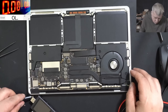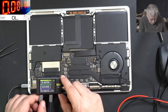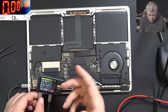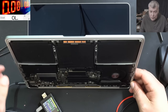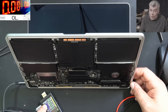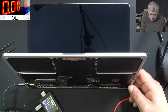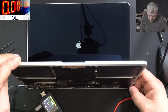That's what happens when someone opens the laptop. Now with the cable reconnected: 800, 900 milliamps, 1 amp, 1.1, 1.2, 1.3 — the battery starts charging. 2 amps. Someone had taken out that cable. Pressing the power button — why is the laptop not coming on? Because the battery is low. The battery is low, and that's the reason why it's not coming on.